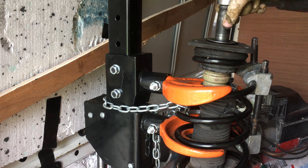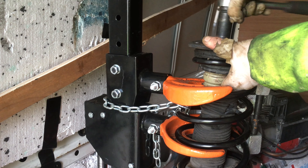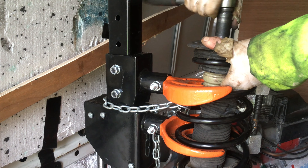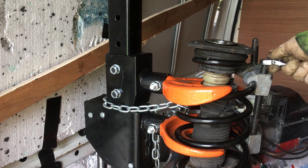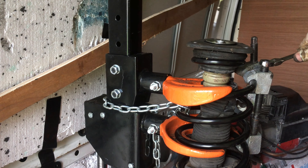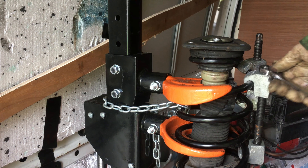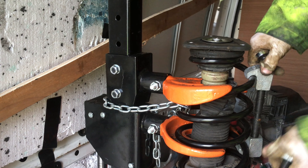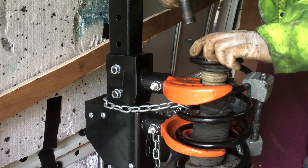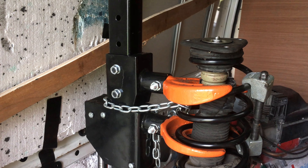I need a little bit of help on mine just to get it nicely seated. I'm just going to tighten down this nut a little bit, just make sure I've got some good tension on there. I've shown in various other videos how to do this without this spring compressor. I use it because it just makes it an awful lot safer — that is the only reason. You can just do it with these little ones here; I kind of just use these as helpers really. Just give this a little blip with the gun.